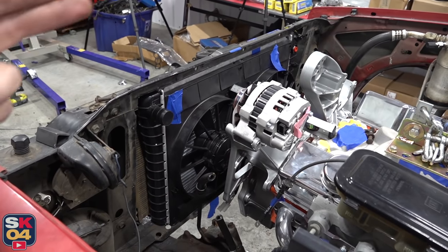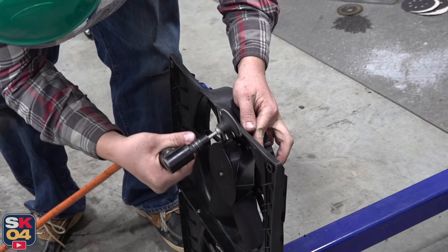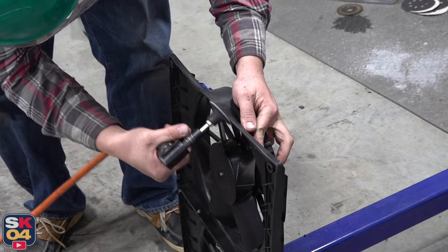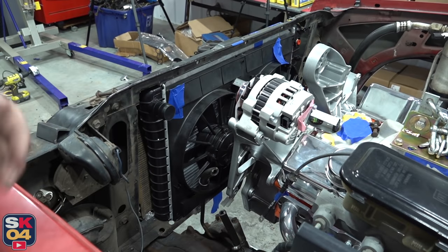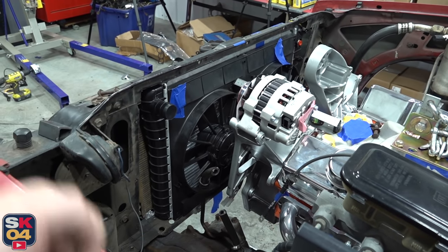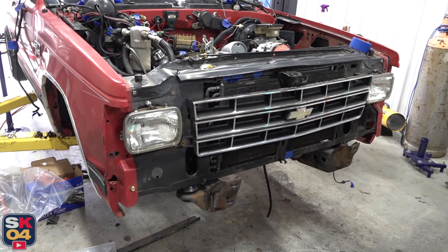The fan shroud had these curved raised portions on the outside edges and a couple down the middle section. I cut those off and made it more level so it sits totally flush up against the radiator. The gaps are way tighter than they were before and it freed up a little bit of clearance. The grill still fits perfect. I was actually just about to make the cradle for the core support, but because I was able to tilt everything forward, I've come up with an alternate design that I think is going to work a little bit better.